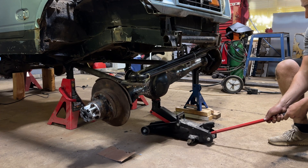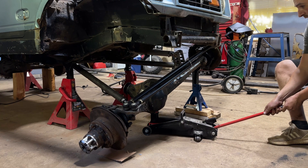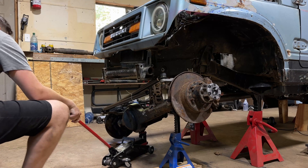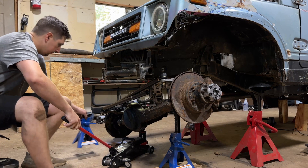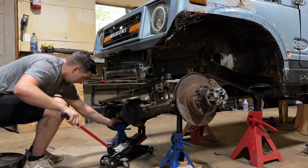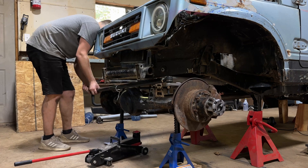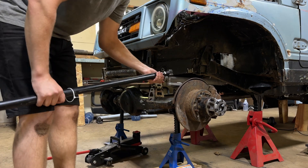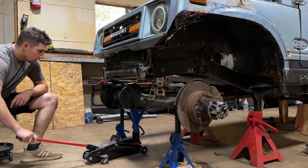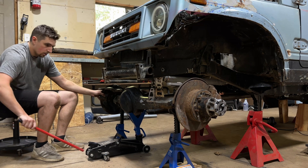This took quite a bit of work to get these mounts together and it's been a big challenge to try to get the proper clearancing around this engine. However, I can't say this is complete yet because I still need to do my panhard bar, and I'm having a really hard time articulating this suspension without it. These links don't have a lot of triangulation and the axle has a lot of tendency to move side to side, so I can't properly characterize my movement throughout the suspension travel to confirm whether these mounts are in the proper place or not.